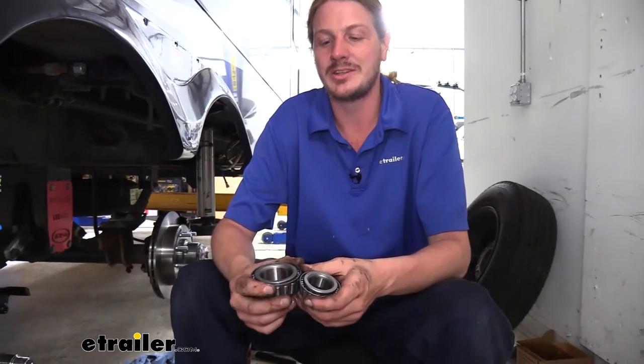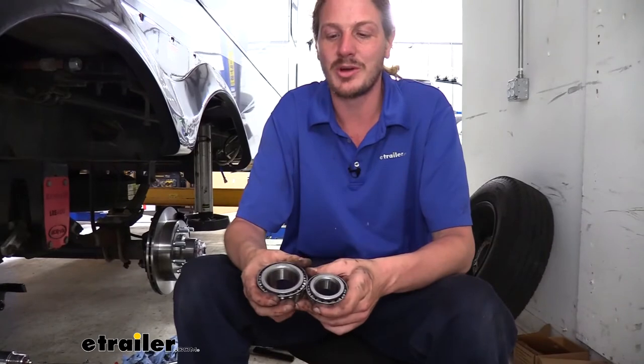To be safe, it's a good idea to check your bearings on one of your wheels before placing your order to ensure you get the correct bearings. Because nothing's worse than getting in here to do the full brake job install just to find out you've got the wrong parts with everything ripped apart and you can't go back together. I recommend taking one off — you can always put that one back together after, but you can get the proper numbers to ensure you get the proper parts.